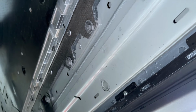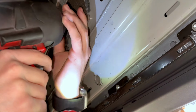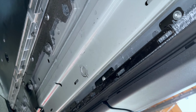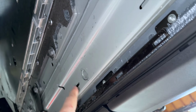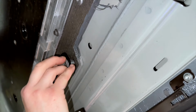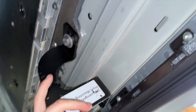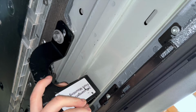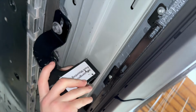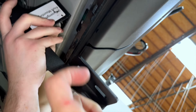And the other one, and then we're going to put it right on. Now you can see how it's going to fit. So we're using this one and this one for the middle, and you're going to put the bolt back inside using the original bolts. And again, this is fixed, so you're going to tighten it all the way, and then the bracket location here will not be changeable. You only have a little bit of play to move it in and out.